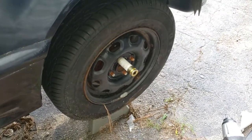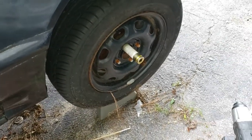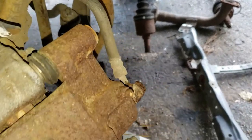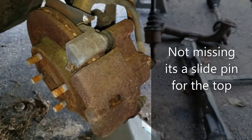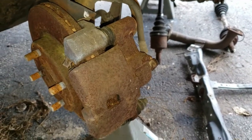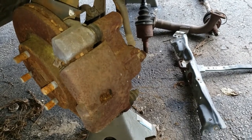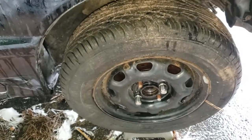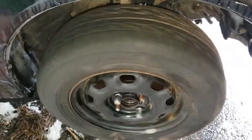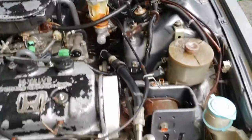It seems they've stripped the bolt onto the car — pull the socket straight off. We'll try to get it off here because the electric impact isn't working. We got the wheel off — the upper caliper mounting bolt is missing and this whole assembly is frozen; the wheel does not move. I want to get this thing off jack stands and get that cross member we're painting up in here so it's stable. We're going to disassemble this entire front spindle to see what's going on — don't know if it's the hub assembly or the caliper. We actually got the wheel off, took the caliper off — the brake pads were seized. The wheel bearing seems to be good; it is spinning. We went ahead and gave it a nice wash and cleaned everything out.